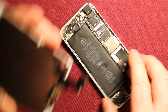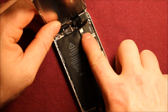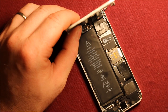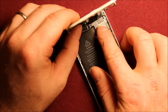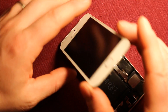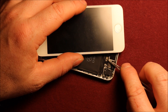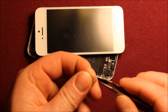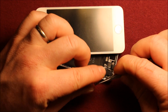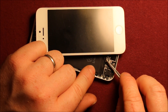To reinstall the front screen, grab your screen and go ahead and set it here and start connecting things. Connect that one and go ahead and connect the next one, and go ahead and connect your front camera. Next grab your connector plate, connect your plate and set it on there, then go ahead and put all your screws back in the right order. Lay this down gently, then connect this cable right here — you've got some slack there. Then go ahead and put this connector back in — it has a prong on one side that goes towards the bottom of the phone. You'll have to hook it over on this side, there are holes, and then pop this part in right here.